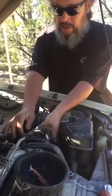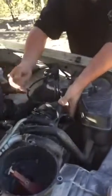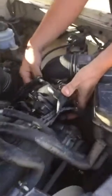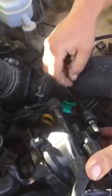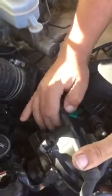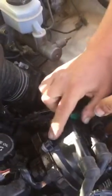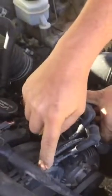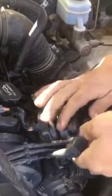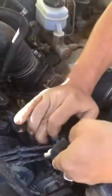Right here's your distributor cap. I want you guys to notice how I marked the cords that I need to take off, so I knew which piston they were going to, so I didn't get confused. I've already taken the screws off. It's pretty easy to take the distributor cap off. There's a screw here, another screw on the back side. So just three screws. On this side, luckily enough, our wires are labeled with what cylinder number it is, so we didn't have to mark those as they're already marked. But you just take these off here,